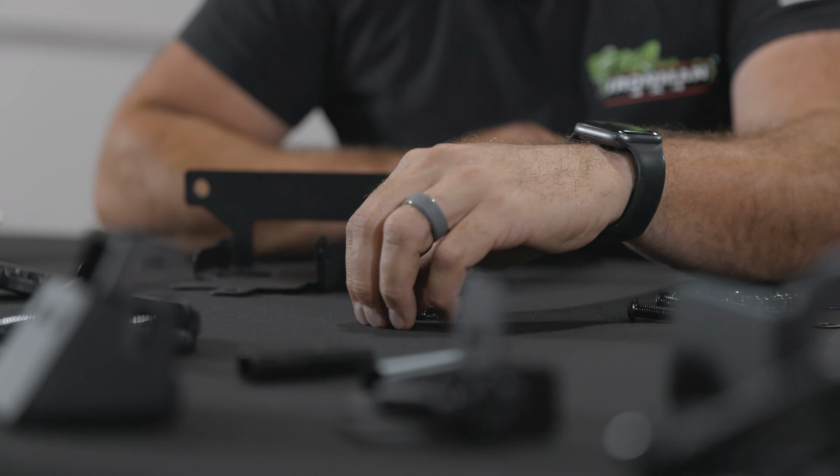Cool. I'm gonna take my little clip removal tool. I'm gonna put it right here behind the headlight. This is all free and ready to go. And I'm gonna pry a little bit, and that just pops right out. Now, as you pull this out, don't go too far because we're gonna get behind here and pull the connector. So just push, that slides off. We'll set that aside, nice and safe. We'll do the same thing on the other side. We're almost ready to pull this guy off.